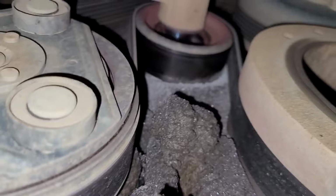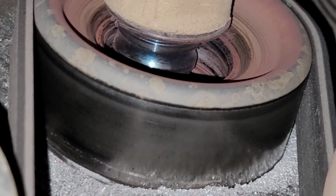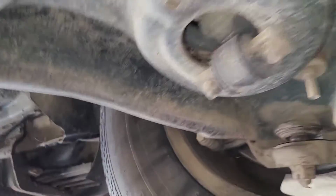All right, I got it up in the air. What I'm seeing on this, whew, okay, let's go. So here is the tensioner. Told you the bearing was missing. Not even there anymore. Look at all the metal ground out from the front cover. So yeah, we're going to have to fix that. Next up, brakes. That's metal to metal.